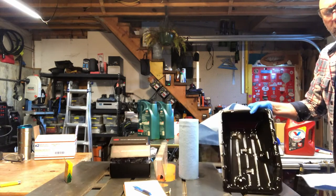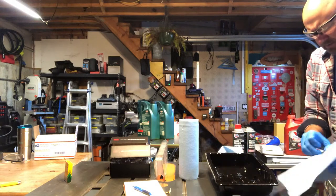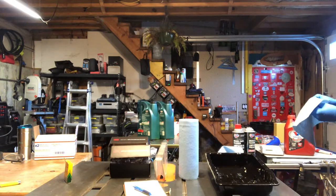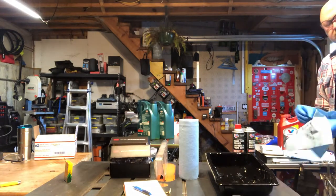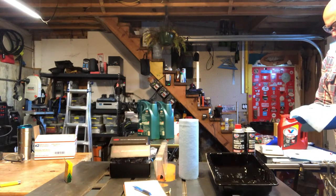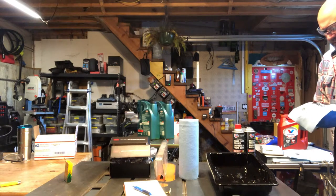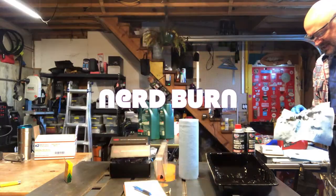You have these 4 magnets, but you'll take each of these off and clean it with a rag. Put them on a clean towel just for safekeeping. Polarity of this magnet doesn't matter when you put it back in the pan because the magnets aren't close together. Because I know some nerd's gonna ask that question.